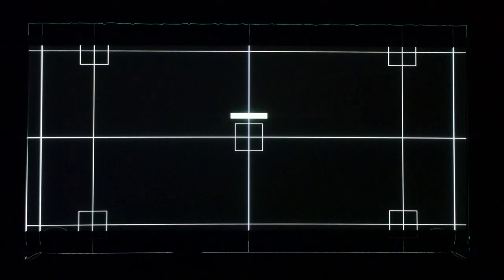That's why screens usually have black velvet borders and projectors have masking features to compensate for slight imperfections. I'm zoomed so the far edges of the projector panel line up with the far edges of the screen space, meticulously managing zoom and shift to get those lines just onto the velvet border. Ideally the middle line ends up in the middle of the screen. You can see the faint overscan lines above and below the screen — those are the actual edges of the projector panel.